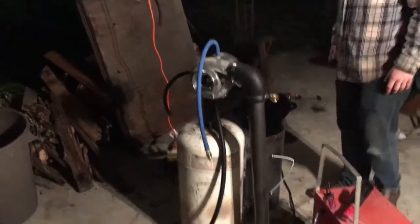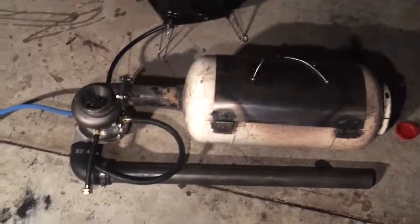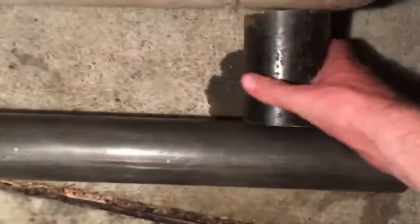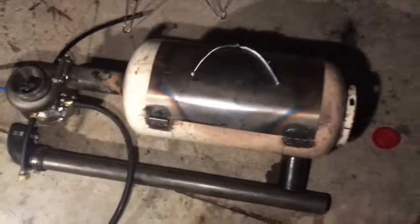Day two wrap-up on the turbo furnace. We're going to quit now because we have a lot more grinding to do and it's already getting to be like 11:30 at night. Here's the layout of the turbo furnace right now. Vincent's got a cool trick where he's going to do a couple of 22-and-a-half-degree cuts so that we can turn the pipe and it will make a 90-degree bend. Then we'll cut a hole in the side of the tank and weld it. We're probably going to use a bit of three-inch pipe to bridge the gap. And that should pretty much wrap it up!